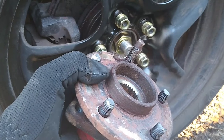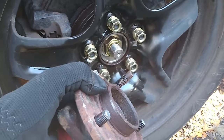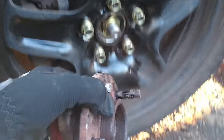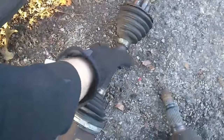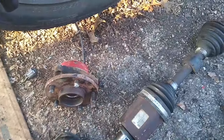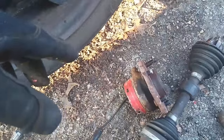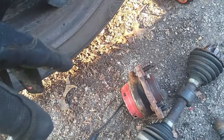That's kind of the reason why I don't use Rock Auto anymore — I've had a lot of bad luck with them. I'm not going to bad mouth them, but if you're going to buy Rock Auto parts, don't buy the cheapest stuff they offer. They do offer some OEM parts; I would go with that if you had to. Here's why the car was in here to begin with: a broken axle. Even in park the car would roll — driver side broken axle. It's frustrating to take a wheel off to change the axle and have these things just spin. It didn't slow me down too much, just muscled them off. But that's a tale of buying the cheapest parts possible — sometimes it's not worth it, because if he'd bought better hubs to begin with, he wouldn't be replacing them today.